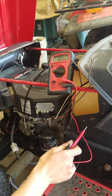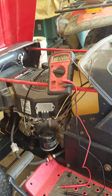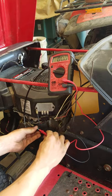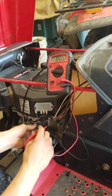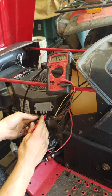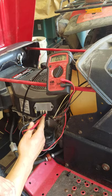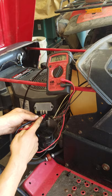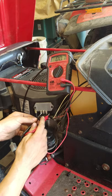Or through the key first. I can show you the ohms you should be getting on it. Between those two leads on ohms, I'm getting 0.7 on one and 7.8 or so on the other. And apparently that is a good voltage regulator ohm reading.